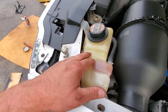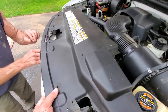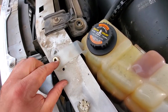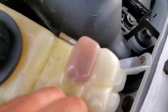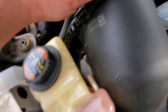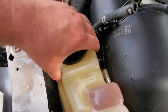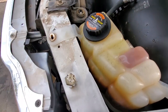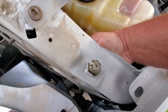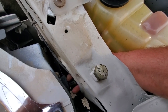If you remove these eight little fasteners in here you can remove this cover. There's an 8-millimeter fastener here and another one in there. Go ahead and take off this hose, unclip your air box, and you can jimmy jam this little coolant bottle to the side. Now we can get our hand in here to access this light bulb. It's a little more work than the passenger side, but you can still get access.